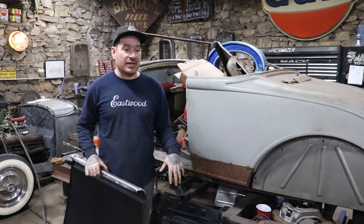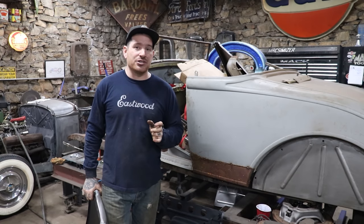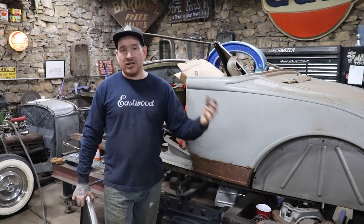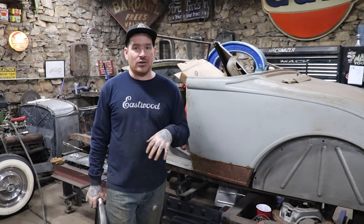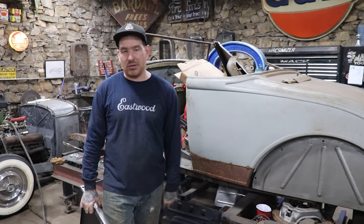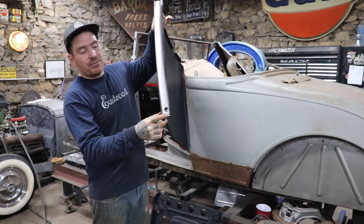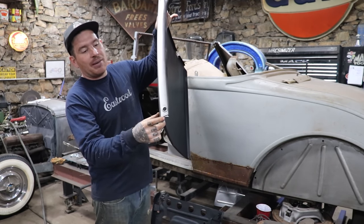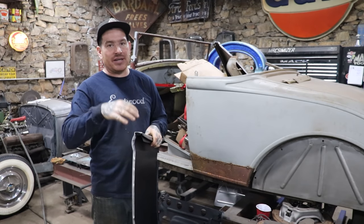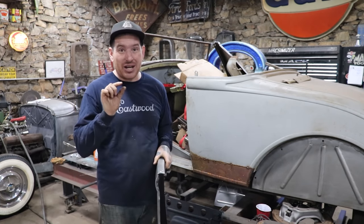Now that we know the door fits good with everything clipped together, what I can do is clip it back together, put it over the hinges, get everything set in place, and hammer some of the edges over on the car just to make sure that everything stays where it needs to go and get it crimped in place in a couple of the corners. Then I'm going to knock the hinge pins out and take it off with half the hinges on. Then I can take it on the bench, hammer all the edges over, tack everything, spot weld, do all that stuff. Then put it back on, and fingers crossed everything fits. The last thing we're going to have to do at the end is just weld up this little sliver that we took out on the top here with the TIG.